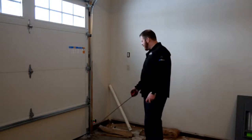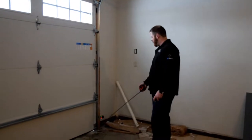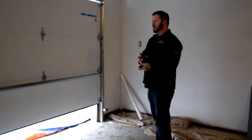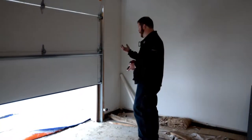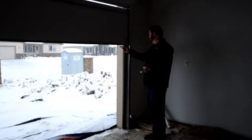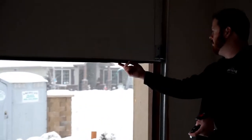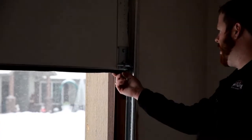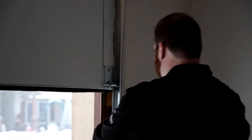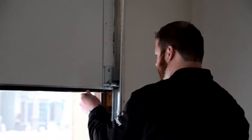What I like to do if I see this light — what happens usually on the door from packaging — I'll run it up for you. The way it's packaged in its box, it gets kind of stuck that way. You can see this seal — I'll stop it here in a second — this seal is sitting down, this bulb seal. Then it comes to here and it gets a little more smashed, and what's happened is the packaging kind of pulls it out.